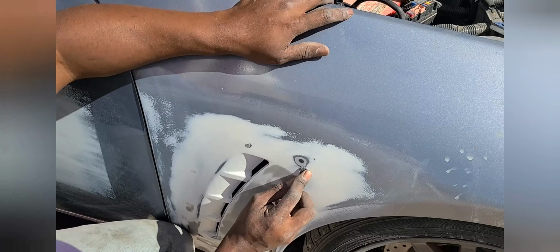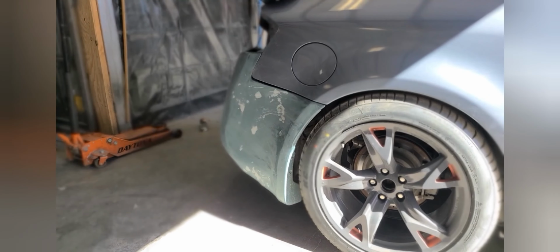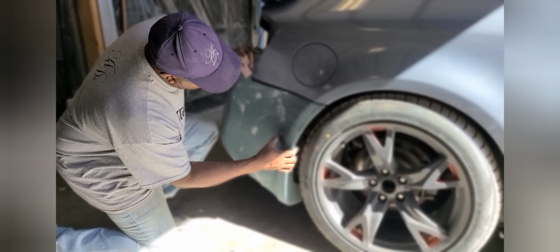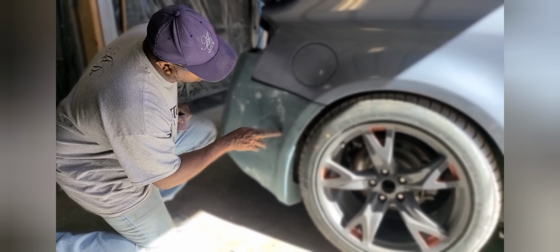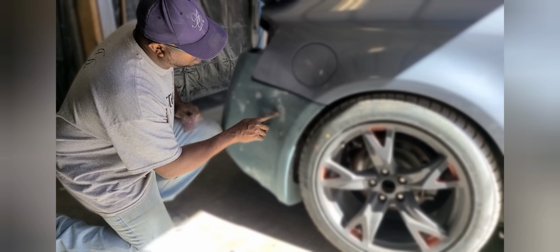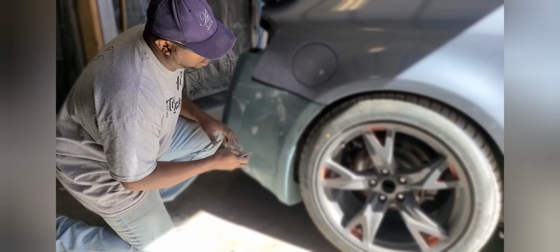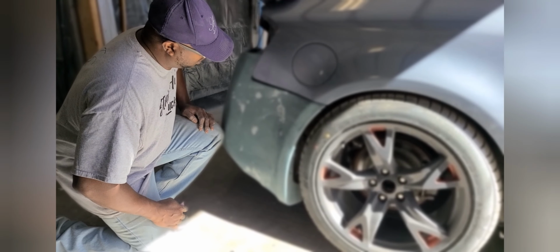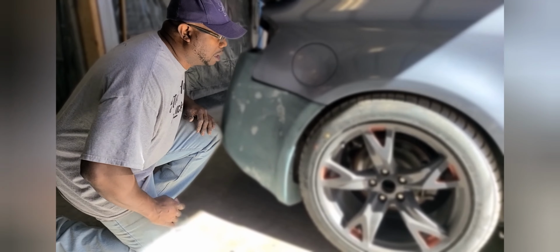Thought I was getting work done today, but more problems. This was a crack, just a bubble, which means oil or something got under here. So we primed it. So I'm gonna sand it down some 80, put more Bondo in there, and do the same with the fenders. So I can remedy that situation today and get it over with.